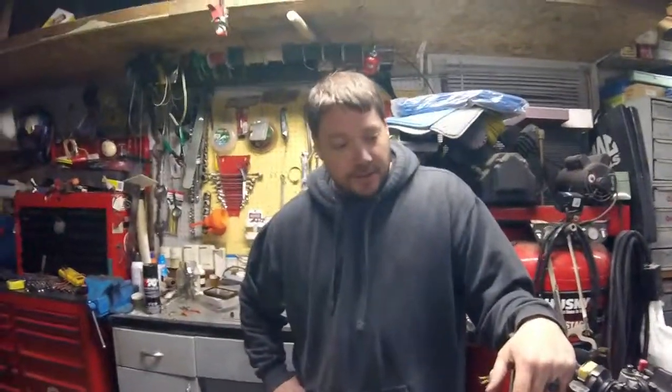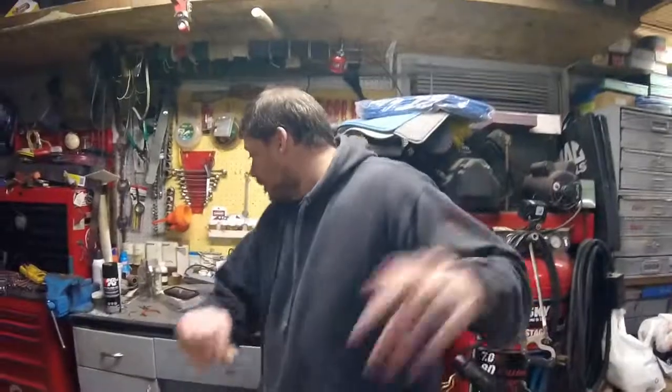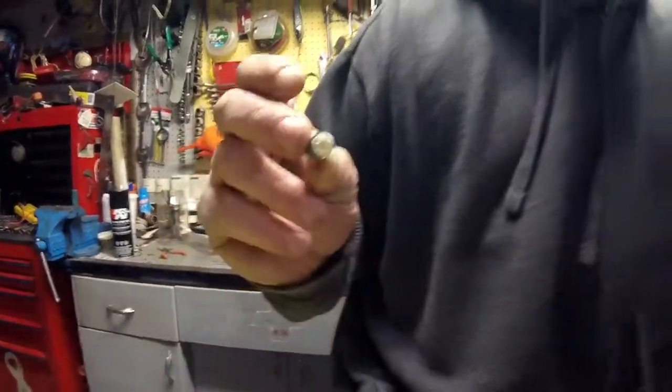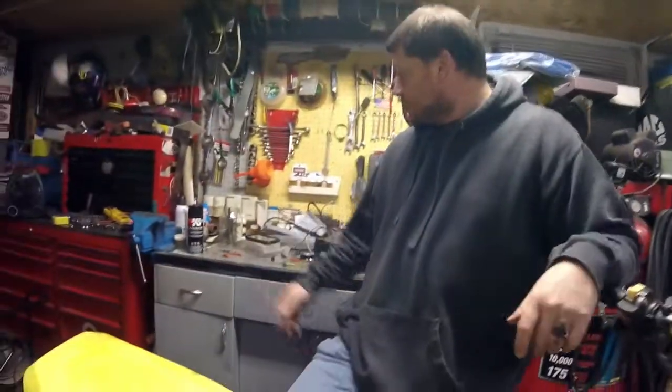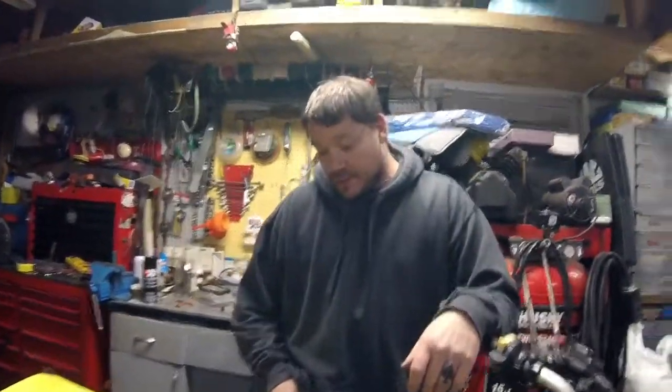Everything seems to be better. Like Trenton said, this thing sounds much better than what it did even throughout the whole racing year last year when we had it out and running. We had multiple issues with idling. And then of course when your inlet screen kind of looks like that, it's kind of a little bit messed up. The carburetor just needed to be an updated deal. Once again, got a 142 main jet in it